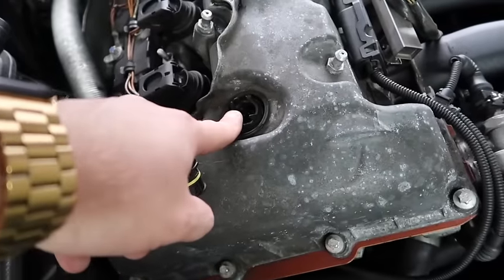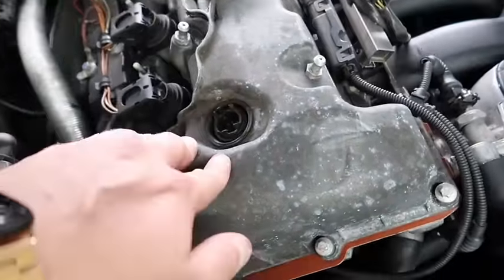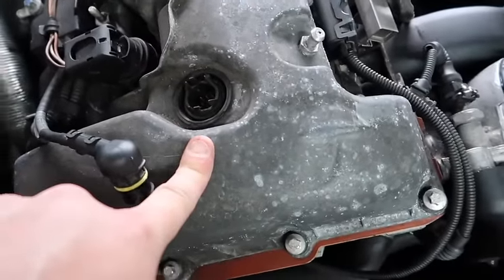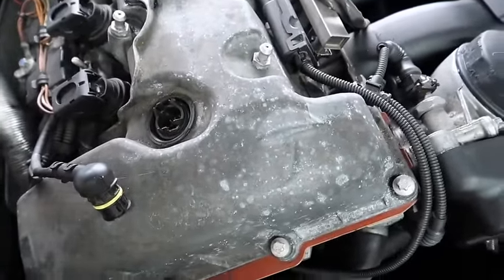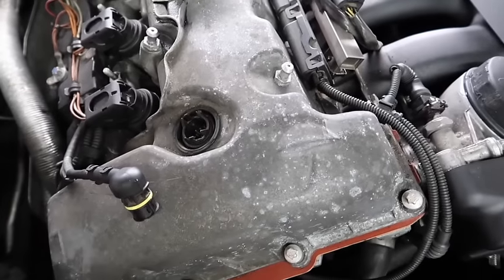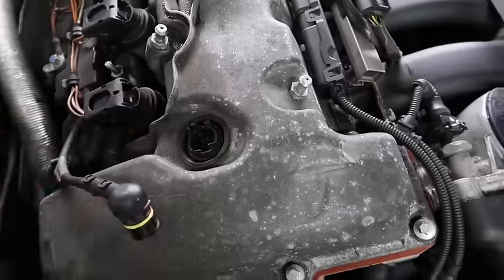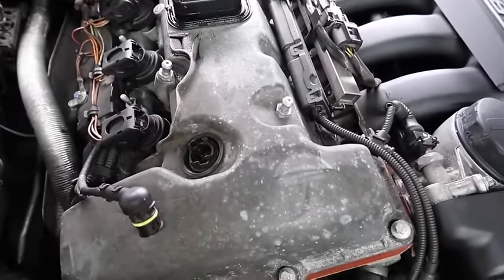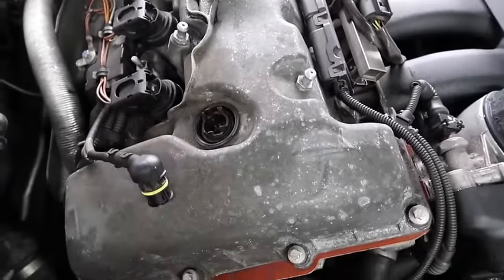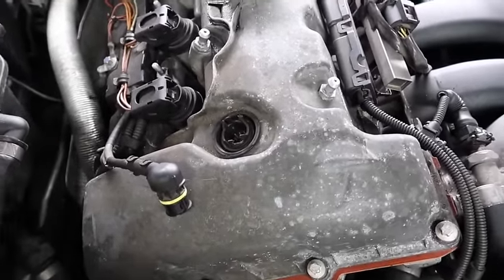There you have it — a lot of people have asked me to do a video on this sensor. It's a common problem, not very well spoken about, but yes — this will cause rough idle, misfire, rough running codes, and even your car cranking but not starting. This sensor is needed to align the eccentric shaft to the starting position when you first turn over the engine. When you're in open loop it's fine, but as soon as it goes into closed loop, your car will likely die.